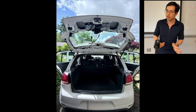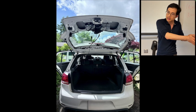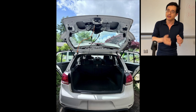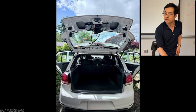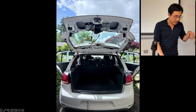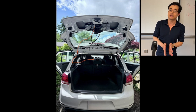The details are all over the place here. You have to do a lot of engineering to get this right. You have to open up the panels in the back and somewhere in the side panels as well. Watch the orange line — you have to connect the flip badge with a couple of lines, and then feed these lines in a way that's waterproof. You have to wire these using the existing conduit in the car. There's a little black tube that helps with waterproofing the electronics. You wire these through the side of the car, inside the panels, and all the way to the front of the car where your head unit is, so you can see the camera feed.